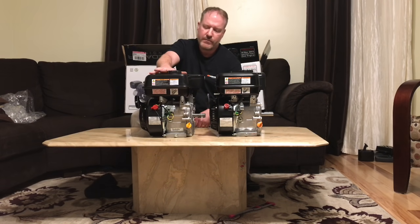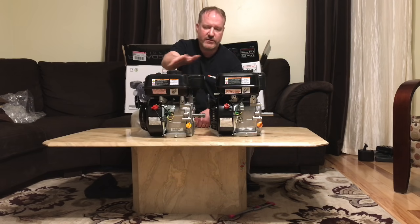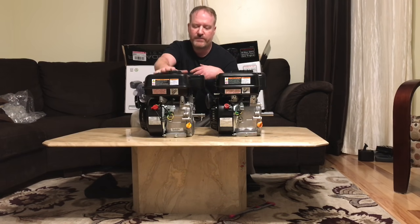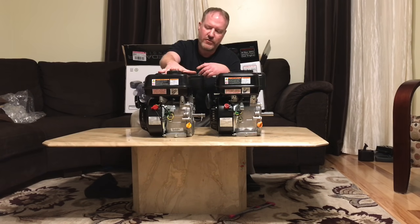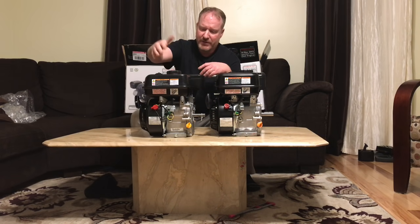Most of the internals are the same because both are based on the Honda GX200. However, the Honda GX200 is 196cc whereas these are 212cc — the Chinese manufacturers copied the design but bored and stroked the engine from 196cc to 212cc. At $99 for these engines versus around $329 for a Honda, you're essentially getting a performance version of a Honda GX200 that's already been bored and stroked, and if you prefer the Hemi design, you can get that too.